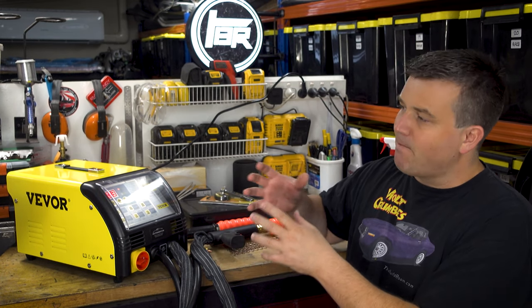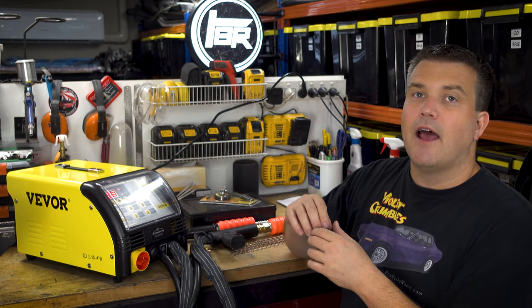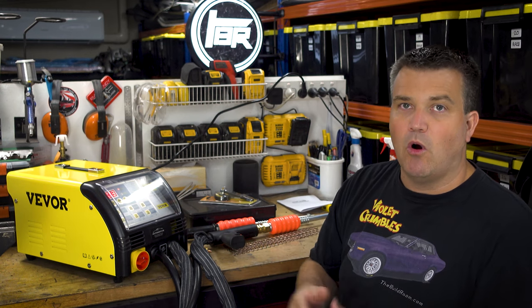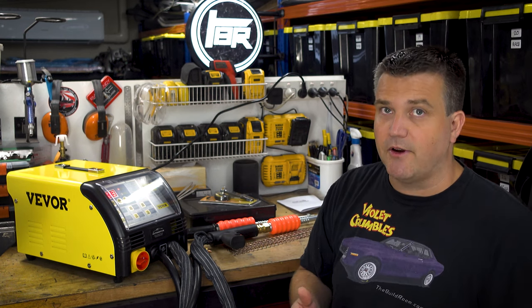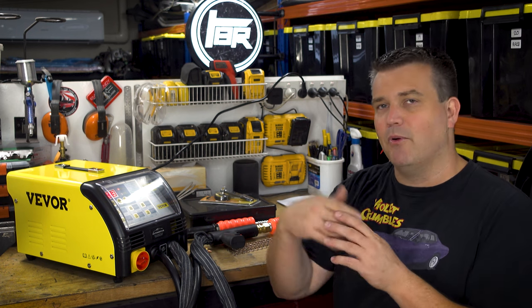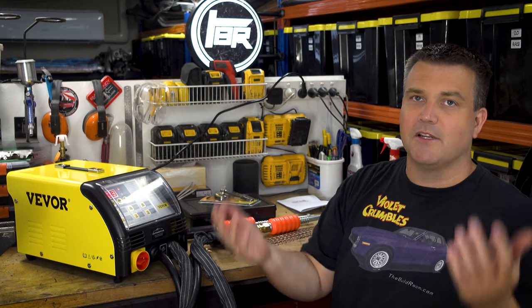And if it was grazed or it's some sort of complex repair, it can get quite difficult to pull those flat, because the more you drill, the more holes you put in it, the more you weaken the structure, and the more time and effort it takes to switch between drilling and putting in your screws and then attaching your slide hammer to the screws and so on and so forth.